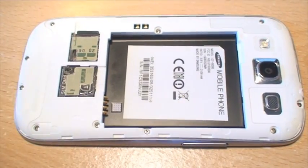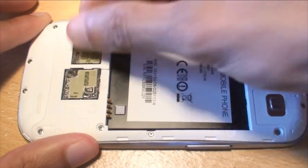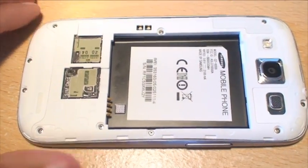The contacts were bent outward so you could actually see them. I did bend them back in by pushing them back, but they must be either bent or just totally disconnected. So we're going to replace this entire block. Phone's off, battery's out, SIM card's out. I'm also going to remove the microSD card just in case that causes any damage.